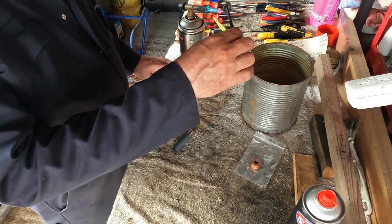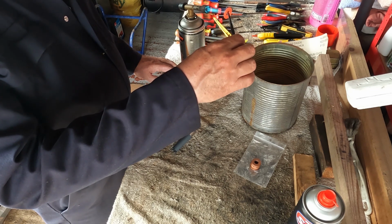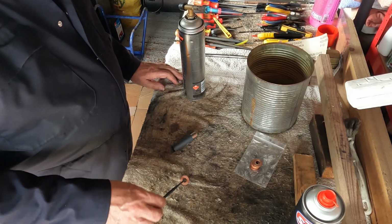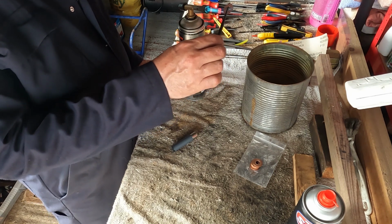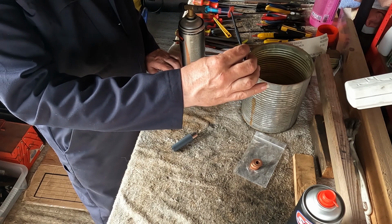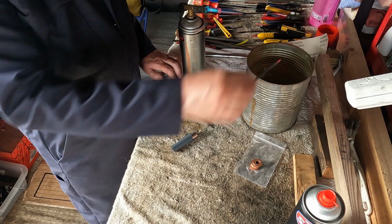What this does, I believe, is change the molecular structure of the copper and give it its sponginess back, so it can compress better and therefore give you a good seal. Just like a gasket, really. There it goes. When I take these out, they'll be covered in black, which is the copper, I believe they call it, copper oxide. So there we go. I'm sure you don't want to see me do all of them. I'll just do this one, get it cherry red. And he goes.